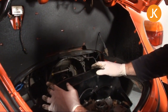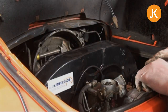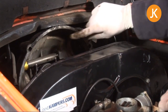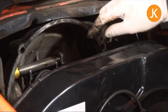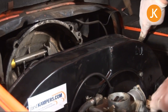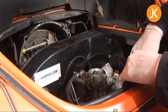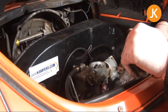Once we're halfway up, when the fan housing's about here, we can push some more of that cable through. Now it's a case of making sure the engine is steady, firm, can't wobble, and gently jacking up. A few things to watch out for just before we start doing the final jack-up: I always like to remove or at least push back these two top bolts so that they're not going to catch when we're engaging the engine into the bell housing. Remember we're going to have to push a little bit more of the accelerator cable through once we're up a bit higher. And the final thing to watch out for is just that nothing catches — the tinware on the engine catching against the engine bay rubber seal, and particularly that top pulley nut catching and lifting up, because that will catch you out.